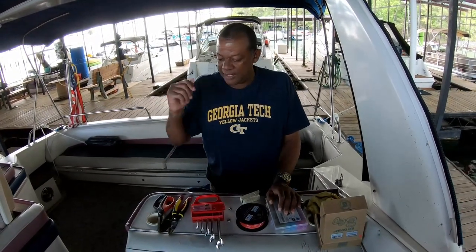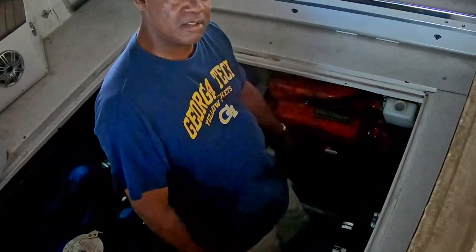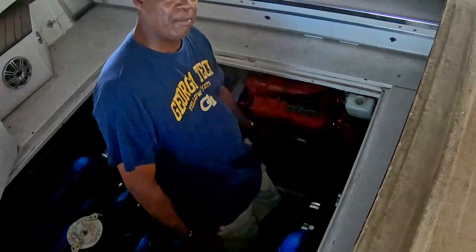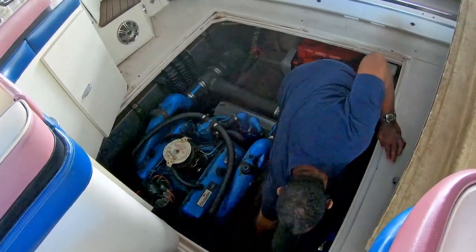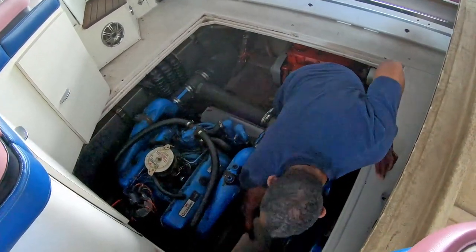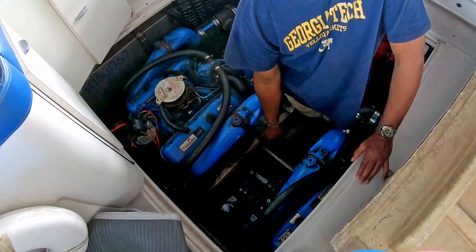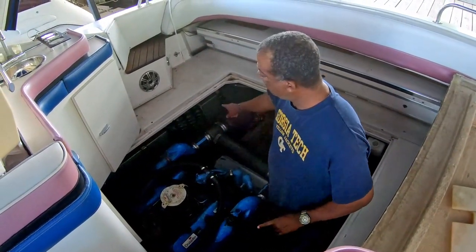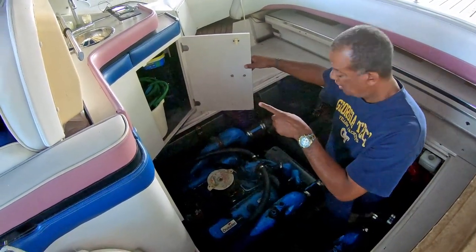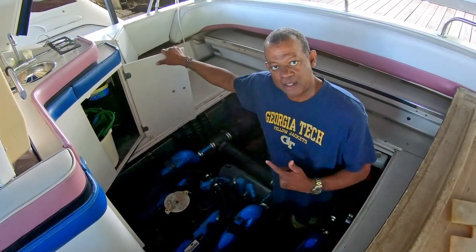Let's get in the engine compartment and get things started. We're down here in the engine compartment. There is my generator. The starter is right here. Solenoid right on the end of the starter — that's where my positive connection is going to go. The batteries are right down here. This particular battery is the battery for the generator, so that's the one we are going to be connecting to. What we're going to do is run a line from the battery around the path, up the side, and into this cabinet. We'll do the same thing from the starter into this cabinet so we can put our button there and just hit it any time we want to get started.